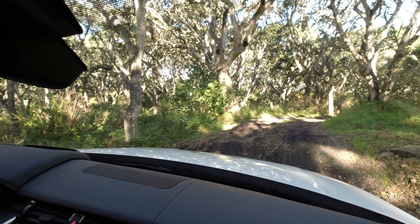On any hill smooth enough that it's not going to compress the suspension and scoop up dirt, if I go two miles an hour I can use hill descent control. If the hill has too many problems and I want to go slower than two miles an hour, I'll use my brake and not build up speed. I check that my low range is still engaged and hill descent control is good. Taking both feet off the pedals is a teaching technique so that on a very steep hill where it's imperative you don't step on the brake, you're already used to it. All this noise is wheels slipping, the ABS brake pump working — hill descent control is doing its job.